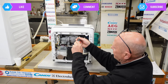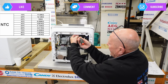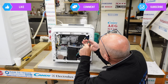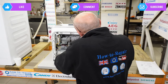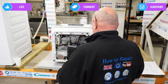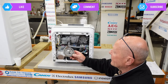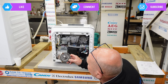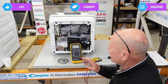The NTC sensor is here, and on the workshop manual there's a complete diagram showing what the reading should be in ohms at preset temperatures. After undoing the three screws and pulling the two wires off, here is the heating element. As you can see, it has two thermostats built into it — these should have continuity across them, which you can check with a meter, along with the ohms reading.